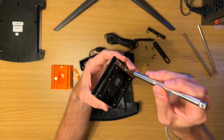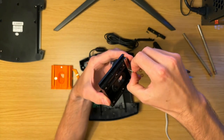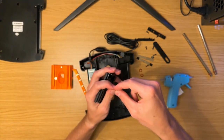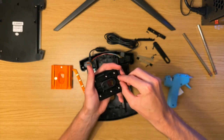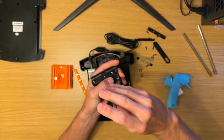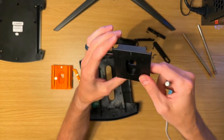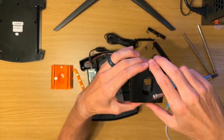We'll go ahead and remove these leaf spring friction adjustments. We'll save the two metal leaves right there, but we're not going to need this screw, so I'm going to put it back on the slider so we don't get it confused with another one. Because I've had cases where people will install that on the new slider, and if you put too big of a screw on the pivot mount, it will scrape the back plate. Very fixable, but annoying. So we're done with that part.